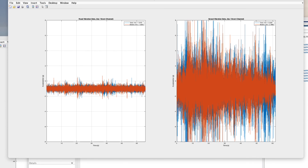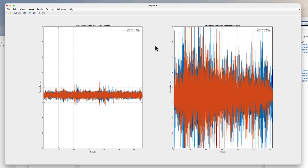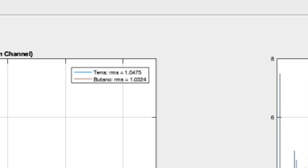That was a clip from the vibrational analysis video on hardtail frame compliance, but the exact same principles apply here when testing handlebars. I tend to favor the frequency domain for analyzing vibration data, but before we fully dive in there is one thing you can take away from the time domain data. The root mean squared, or RMS, value of a time domain signal gives a normalized value that corresponds to the relative amount of energy in the signal. I've gone ahead and calculated the RMS values for all the datasets.